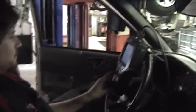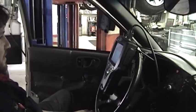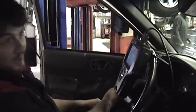We're waiting for it to come up with the diagnostic trouble codes stored in the ABS system. Left front wheel speed sensor — open or shorted. So that's this side. Alright, so leave that pulled up and we'll get it high.